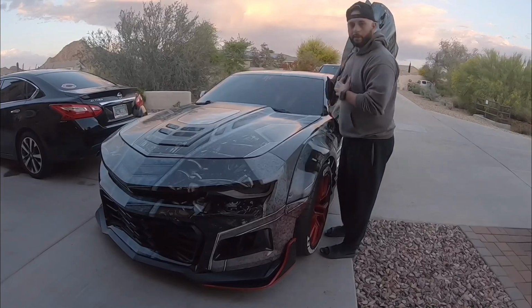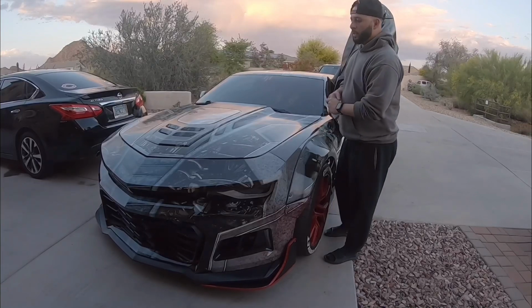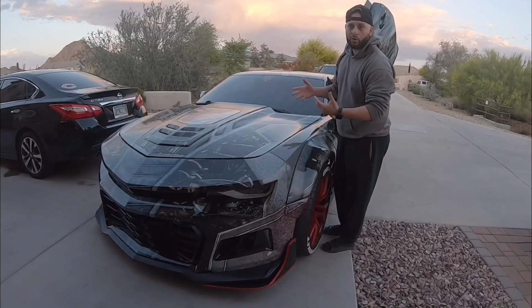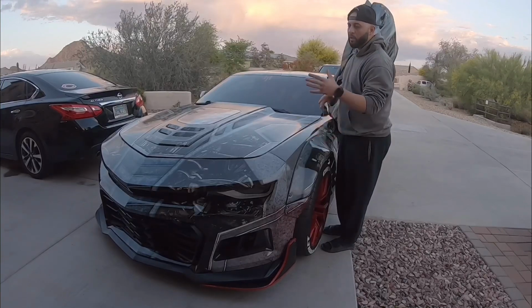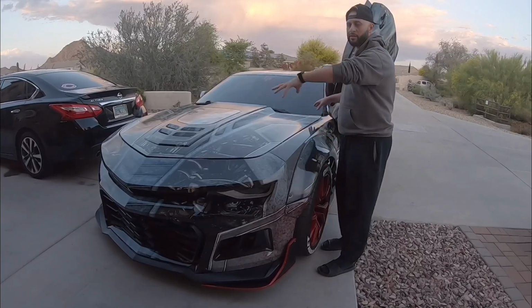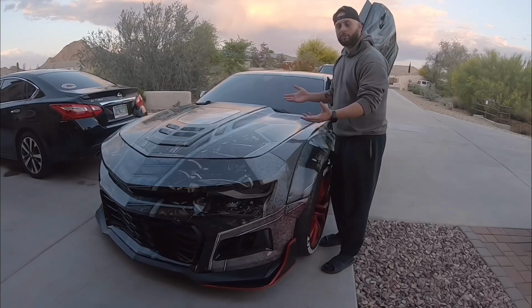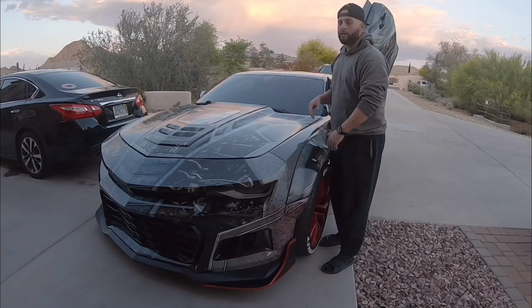I've already got the latch popped from the inside of the car. When I first got it, I was nervous. I didn't know how to use the setup, because it was completely different. It legit took me 9 hours to put this kit on the car, because you have to take off your bumper, and change the hinges and the latches that come with it. You also have to change the cables they send you for when you pull the latch, so that the hood can release. There actually become 2 cables now. It's crazy.